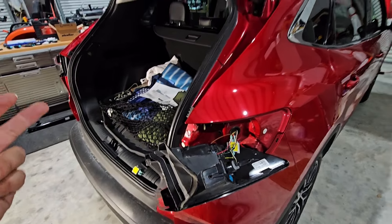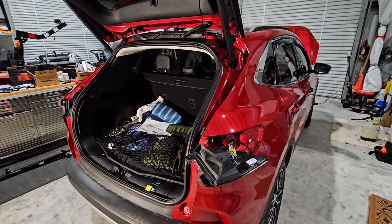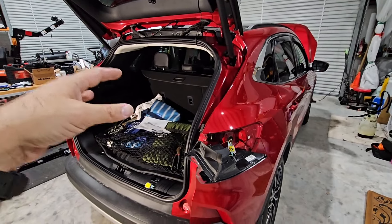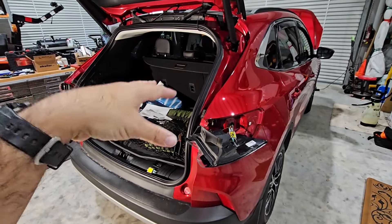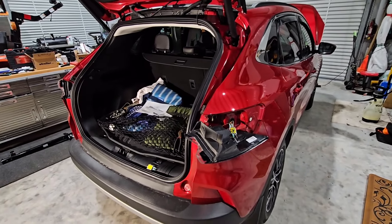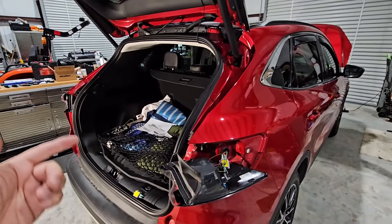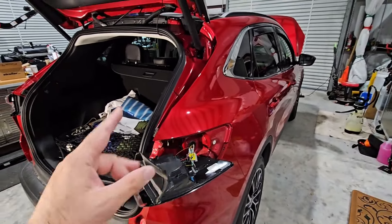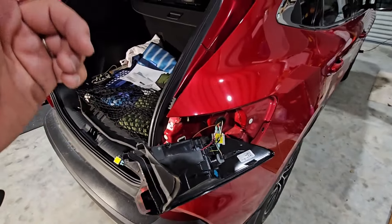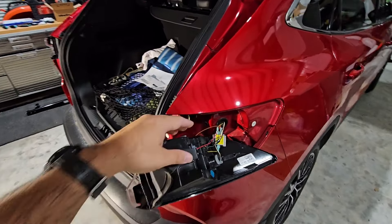We came up with the idea that maybe the battery on this hybrid was dead or too low, and the voltage had dropped. We tested it and that's what happened - the battery voltage was like 7 volts. It's a 12-volt starting system even though this is a plug-in hybrid with a battery pack, but you still need to maintain the main 12V battery. We couldn't even move the vehicle because we didn't have enough power from the main system to kick in the hybrid system.